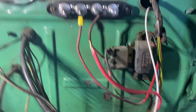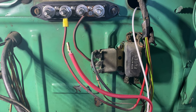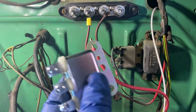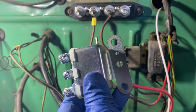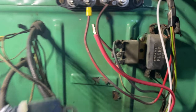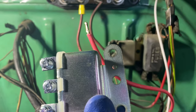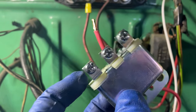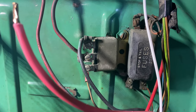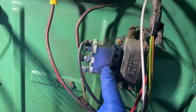The last thing to do under the bay is replace the horn relay. From what I read online you don't have to do this, but the kit came with a new one meant for 12 volts, so for longevity it makes sense to use it. Pretty straightforward: remove the two bolts, plug the wires in the same places they already are. Done — replaced the old one and put the wires exactly where they were. Not complicated at all.